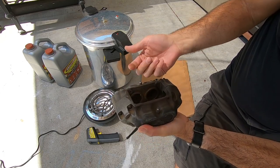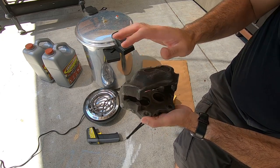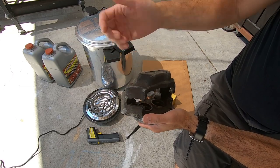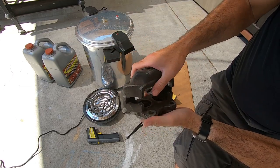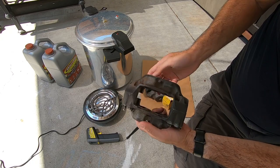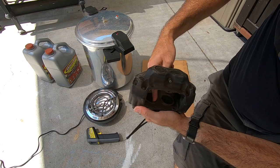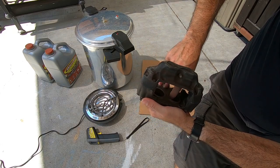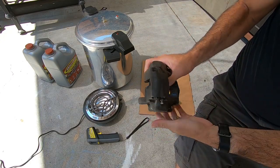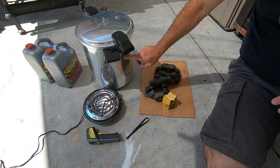The only concern is that the vapor rust is going to get inside all the channels within each of the calipers, but it won't cause any more rust and it won't harm the inner rubber o-ring. Once I flush the brake fluid, it'll get it all out. De-rusting the inside should help — I just have to make sure I do a couple of extra flushes. Then I'll come back, smooth it out with really fine sandpaper, get some grease on it, get the pistons back in. I think these will be totally refurbished.